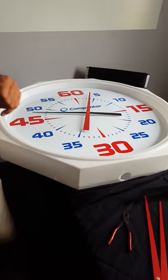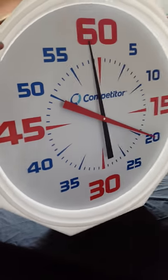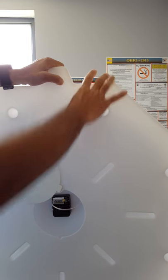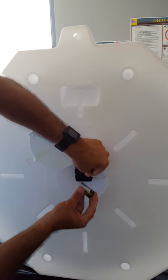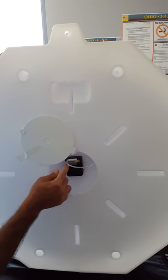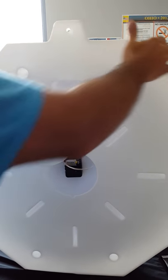Now, I rushed through that, so here's the finished product that should be secure. There are a couple things I want to tell you about the motor. When you receive your clock, you're going to see the on-off switch — it connects to the button up here, and this is what turns your clock on and off. There is a foil contact — this is the negative side of the battery. Make sure that the battery is securely fastened in between with the foil. That is critical, otherwise your clock won't work.